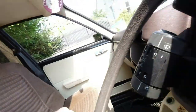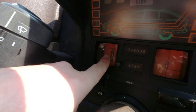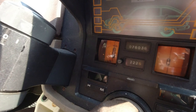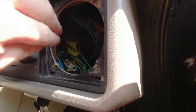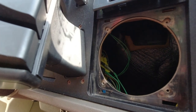The cable itself plugs into the back of the speedometer here and it's just a push fit. I've had it off and on a couple of times trying to see whether it's just come a bit loose, but it doesn't seem to make a fat lot of difference. The access is terrible, by the way. On the left-hand drive ones you'd easily be able to get to it, but on the right-hand drive you have to go through this speaker hole here and ram your arm in and get it ripped to pieces to just about reach it. Nonetheless, I can easily pull it from the bonnet end.